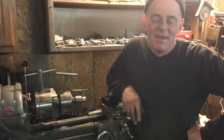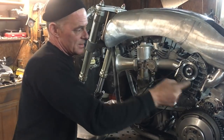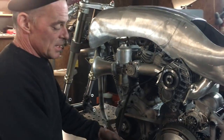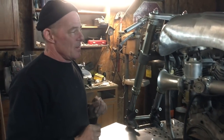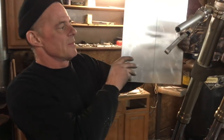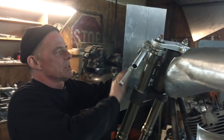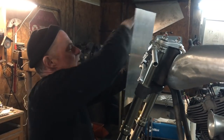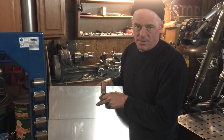This week we got quite a bit done so we can charge some super into the motor. We've got this belt that'll be tight, running off here. Got my plumbing going all the way around there — nice volume for my plenum. So I've got the starter about where I want it. Now I want to do the fairing. This is the start of the fairing. I decided I'm going to make this in, for the most part, three pieces — two sides — because we're just going to have slots for the handlebars to come out. This is going to go around and we're going to have a little screen. People often ask me: it's 3003 H14, 80 thou thick. That's what I use.